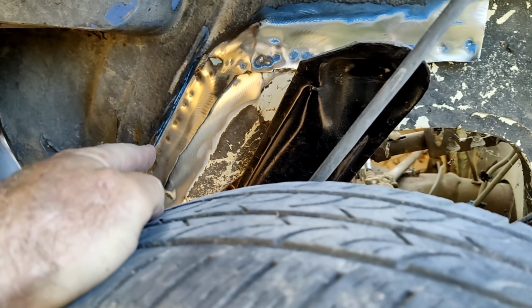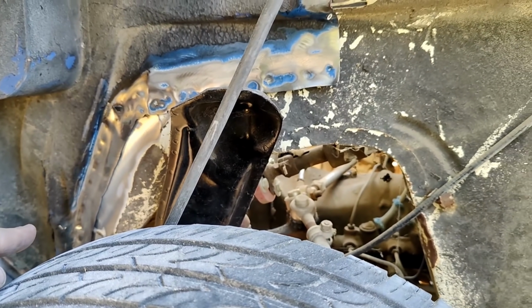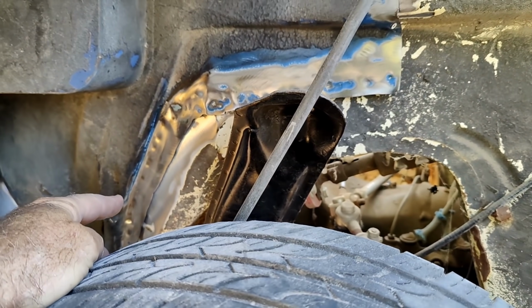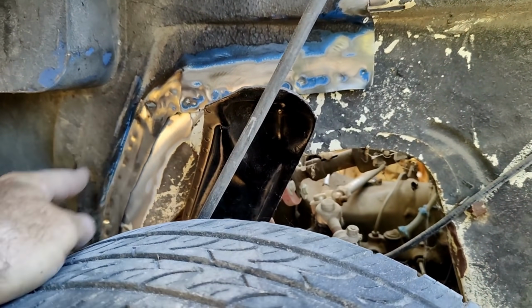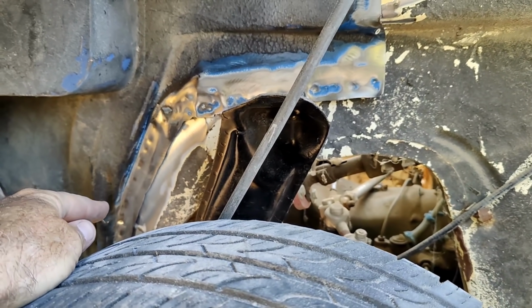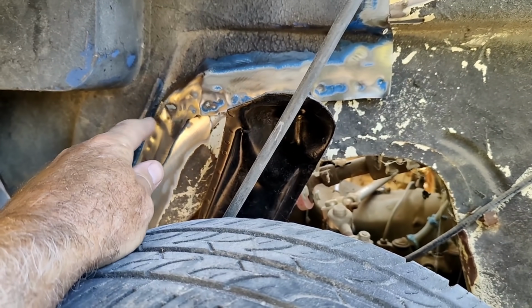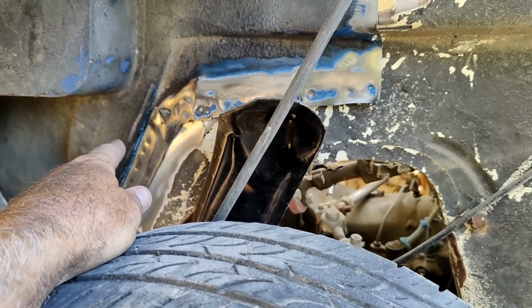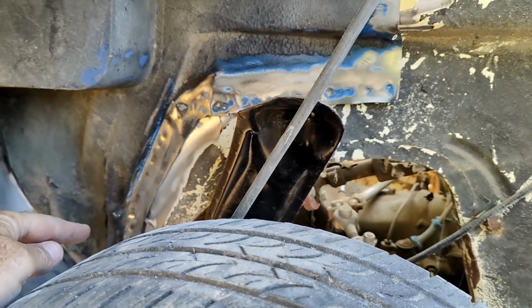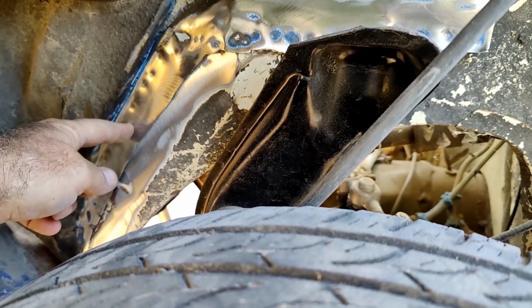So now what I gotta do, I gotta clamp and fill inside here. Let's see if I can get a camera angle in here. That'd be fun. Or clamp and weld along the bottom edge, just spot weld it every half inch on center. And then I may drill a few and put some up above that, just to strengthen it up. So I'll have some along the bottom edge on here, and then some up about right here.